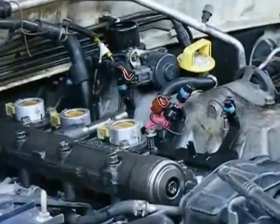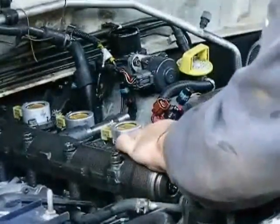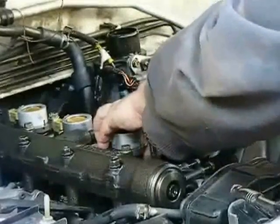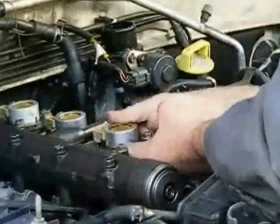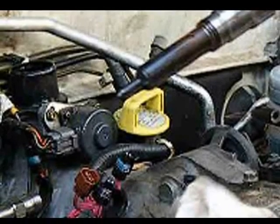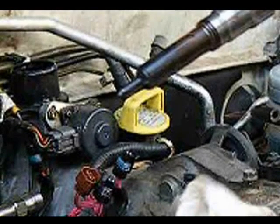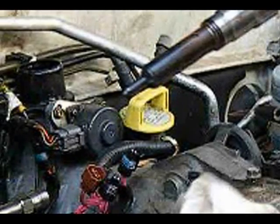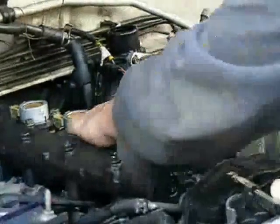So I was wondering what was wrong with the engine — was it a head fault? So injector number two comes out. See the burnt material — it's obviously come up from the combustion chamber. However, the seals have been leaking. Definitely cylinder number two has got leaking injector seals, and probably sleeve seals as well.